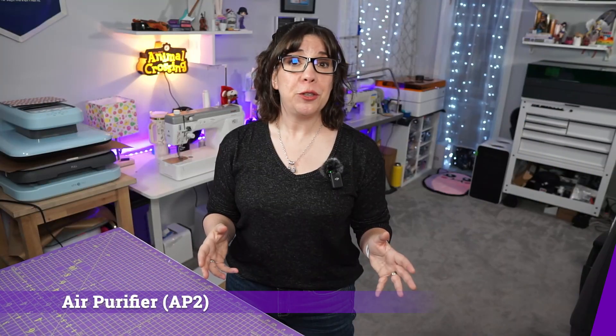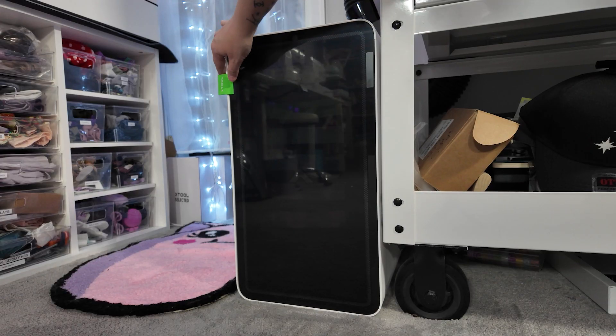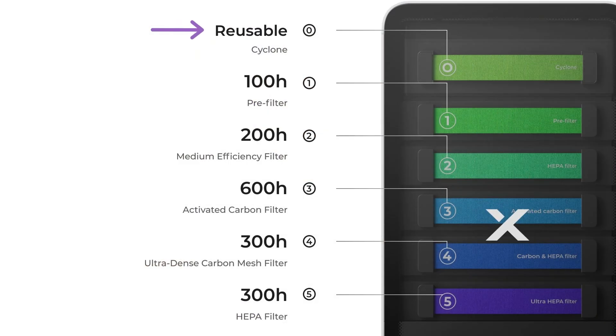The AP-2 has six layers of filtration. The door is basically an acrylic panel that snaps on using magnets — no hinges. You just take the door off and slip it back on, making sure it's secure. The IF-2 plugs directly into the AP-2 system, and the first thing you'll notice is it's huge — bigger than my top-of-the-line gaming computer. Going through the six layers: the topmost filter is the Super Cyclone, your main filter and first line of defense. Next is the pre-filter, followed by the first HEPA filter. The middle layer is an activated carbon filter, then a combination carbon and HEPA filter, and finally the Ultra HEPA filter.